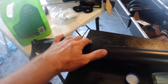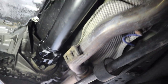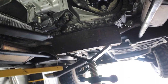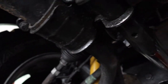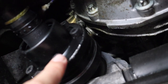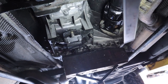We're going to throw this brand new one in. It's actually really easy — it should get rid of that noise. Once you remove the brace that goes over here and this brace, it's just a few 16mm bolts — there, there, and there. Make sure you support the transfer case because it's the transfer case bracket. For the drive shaft itself, it's pretty easy: these are also 16mm bolts, there are four of them, and those Allen bolts are a seven. Just break them loose and spin it around. When tightening, make sure you cross-tighten them. The new shaft is in — it's 500 times better than it ever was. We're going to throw the bracket back on, pressure wash it, and we should be good with this part.